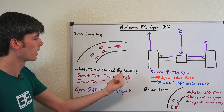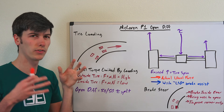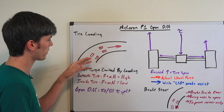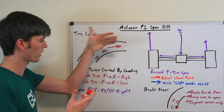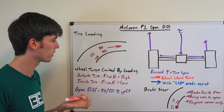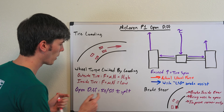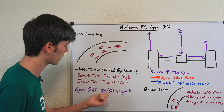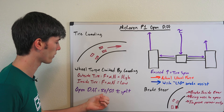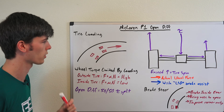The outside tire will be able to accelerate with a higher force than the inside tire, simply because there's less load resting on that inside tire — most of it is on the outside tire as you're going around the corner and trying to accelerate out. Now here's the problem with the open differential: open differentials always have a 50/50 torque split. A lot of people don't realize this, but I've got other videos that explain why.